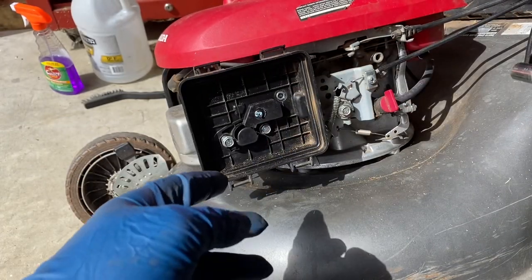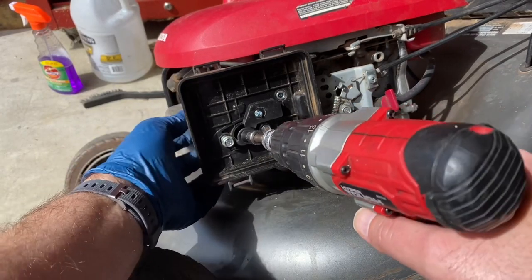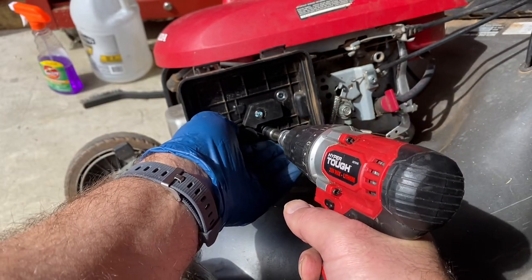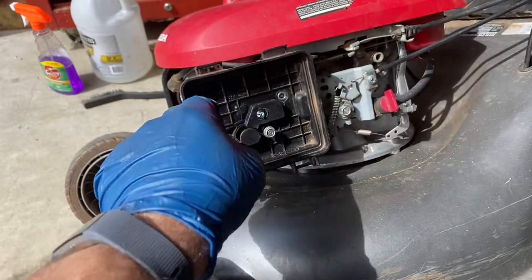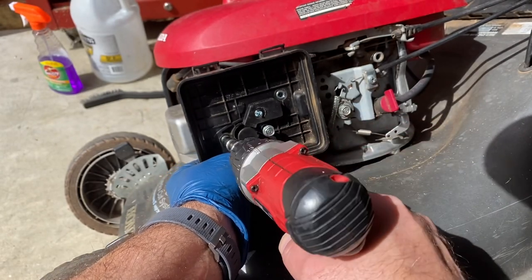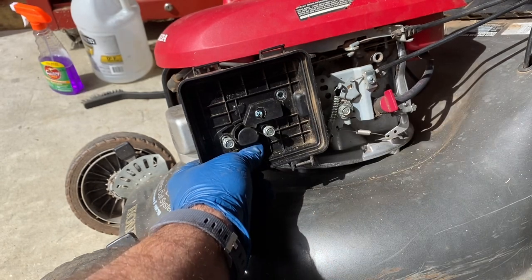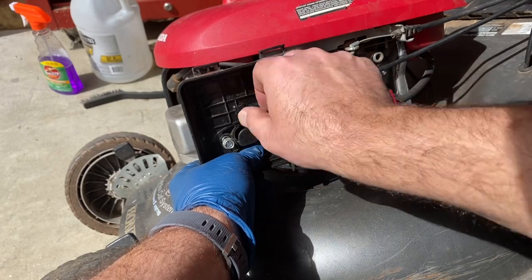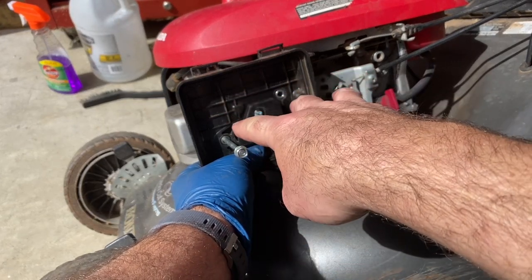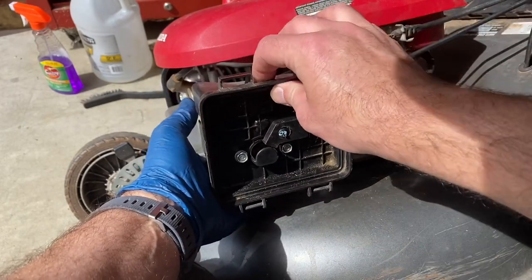This is one of these carburetors that's sandwiched together. I forgot. If I take this whole thing out, the whole carburetor is going to fall apart. So I'm going to leave those in there a little bit like that, leave it pushed in and then take these out, so it just doesn't fall apart. See, these are the studs that hold it. Most carburetors, the studs are fixed in, and then you slide the carburetor over them. So it didn't make it this difficult.